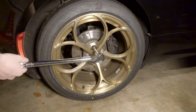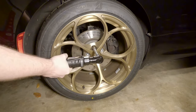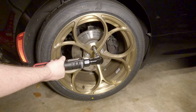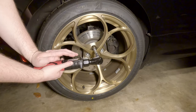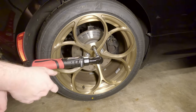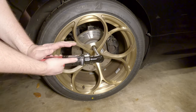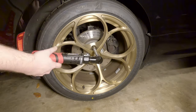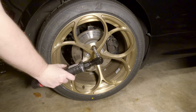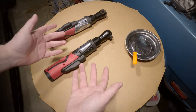Resetting for 65 — and 65 is where the three-eighths would crap out. It moved it a little, but I think it's basically topping out the same place the three-eighths topped out. I'm not really sure where they're getting the extra five foot-pounds from in the spec for the half-inch. But it doesn't really matter, because the best way to use this ratchet anyway is to break the fastener loose with manual torque and then spin it off. It still saves you a lot of time and sore wrists.